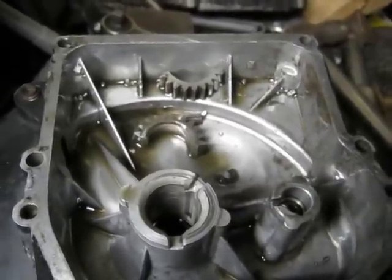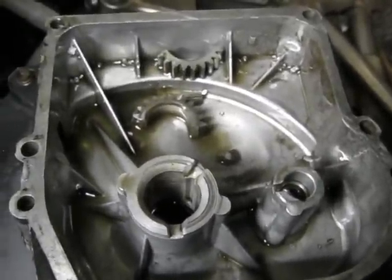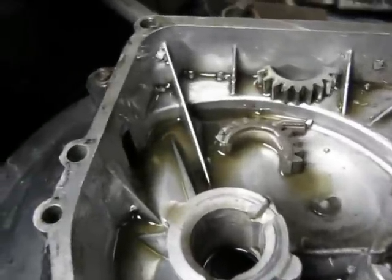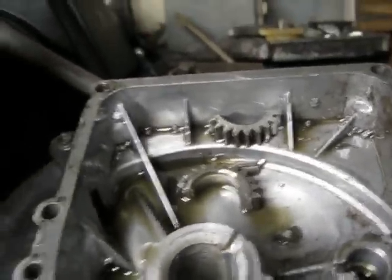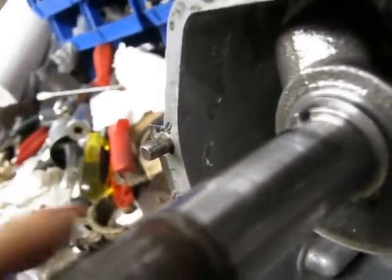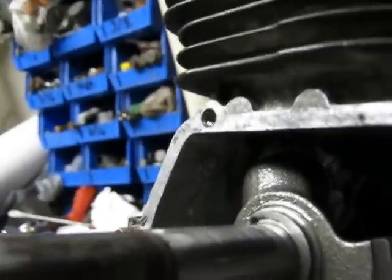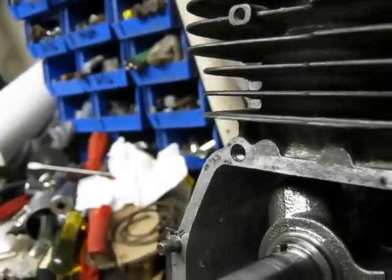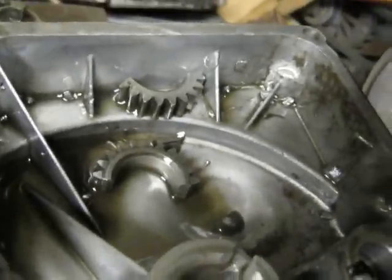Tearing down the three-cylinder 327 - this is cylinder number three at the bottom. As you can see there's some carnage there. The crankshaft timing gear snapped in two pieces and there are some chunks of stuff around the crankcase. I see a gear tooth, and there looks to be some aluminum too. You can see some score marks up in here. The con rod looks to be in one piece. I can't turn the engine over - something going on with number two cylinder I think too. But at least it didn't blow a hole in the side.